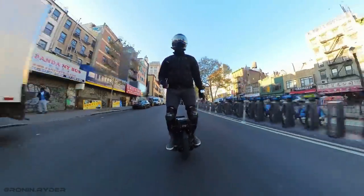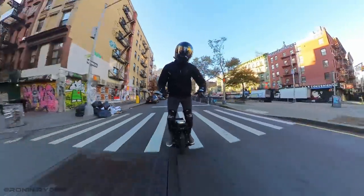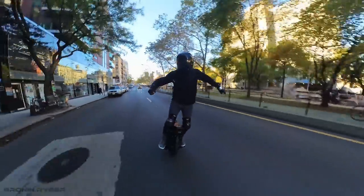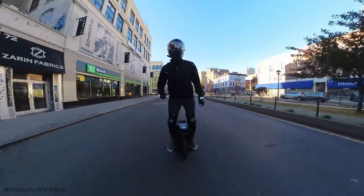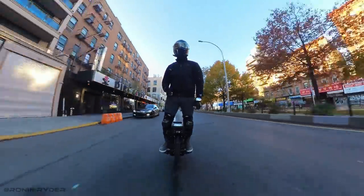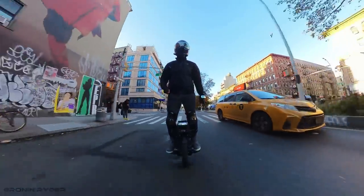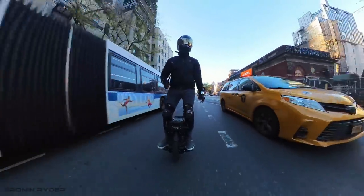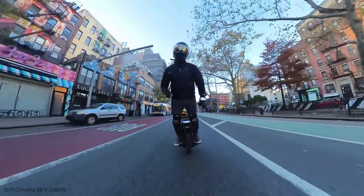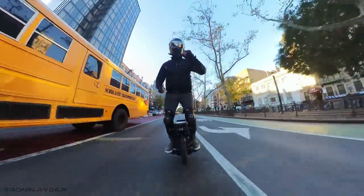The CST knobby has a flat profile. When I was riding, the Lynx would balance left and right constantly. It was really uncomfortable. With that tire, the Lynx would also be very impacted by strong winds. I would like to explain the following. If you are a rider that prefers to ride at slow speeds, you won't be impacted by the negative effects of the CST knobby tire. The stability issues of this tire will only happen if you decide to take advantage of the full power of the wheel and ride at higher speeds. You will also have this problem if you like to carve.